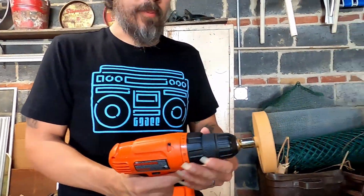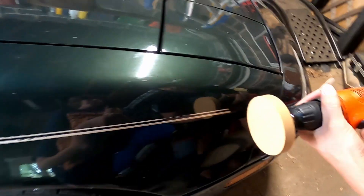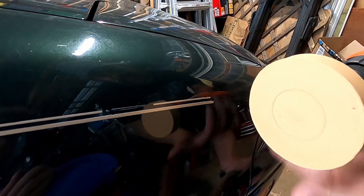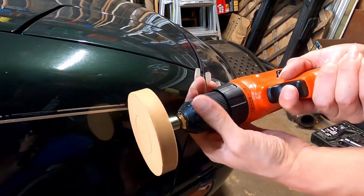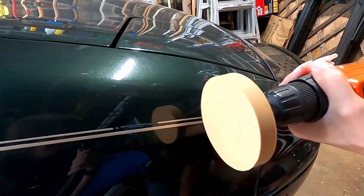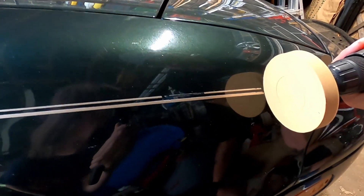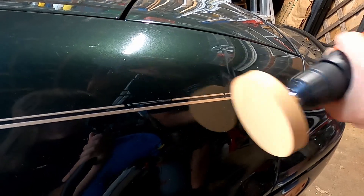You want to go forward. When you're getting down to it, make sure you're close enough and comfortable. Make sure you're not going to hit the car body with the drill — I'm keeping my arm here. Don't put it where it spins, obviously. Then you're going to be going in a back and forth motion. At first it's going to naturally want to go up, so lay it on there first and then start using it. It's really hard to control at first.